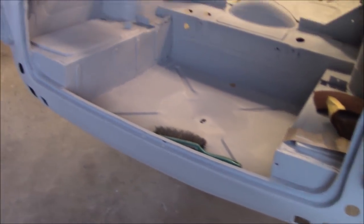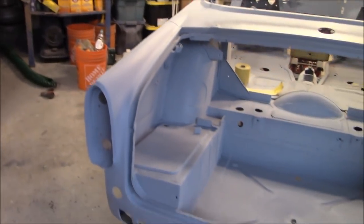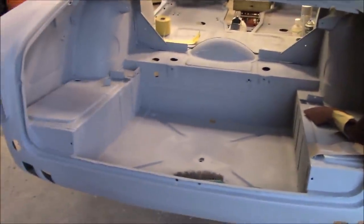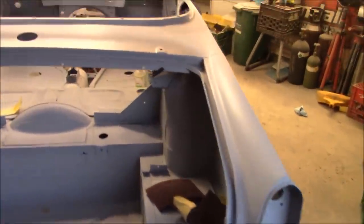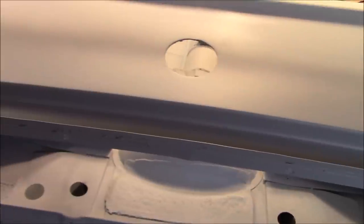Quick update for the end of the night — it's a nice night, just a little shy of 90. Pretty much got the exterior panels and some of the interior of the trunk sanded down with 400 grit dry. Just about to start on the 600 wet, and I came across an area I wasn't happy with — there were some runs on this back shelf channel area. I ended up sanding that back down to bare metal and repriming it, which took a little bit of time.